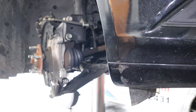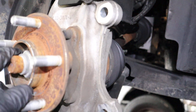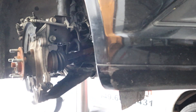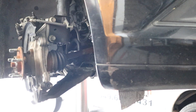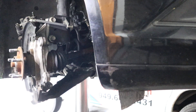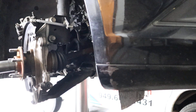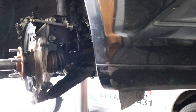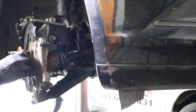Let's see what you guys can see — two bolts on this side and two on the other side. I've got to take this axle nut out; you've got to get them from behind though. Using the thunder gun. If you're doing this at home and don't have power tools, put a half-inch breaker bar on the ground, put the car in drive, and it should unscrew the bolt. You didn't hear me say that — I don't take any responsibility for it.